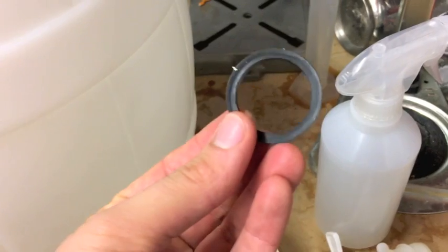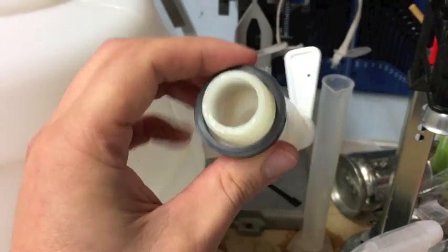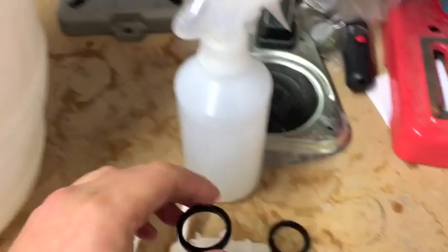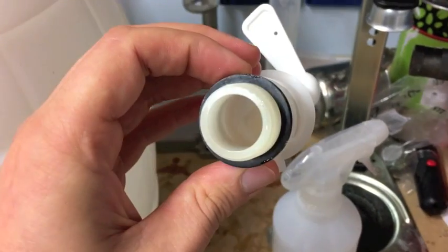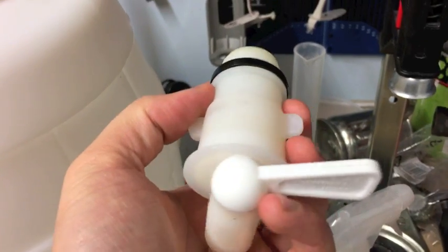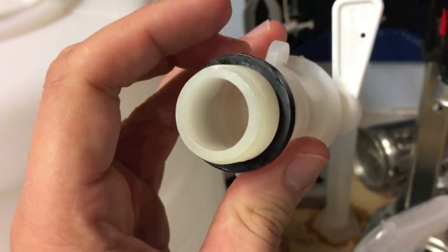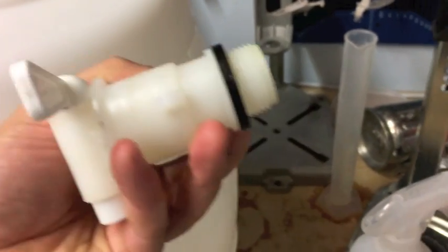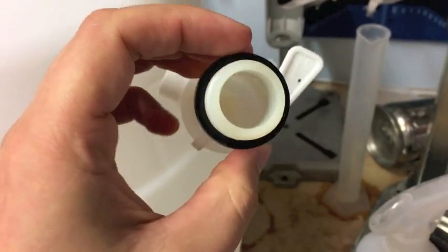The rubber washer for the tap has actually deformed quite a lot and is not really usable anymore — you can see how loose a fit it is, so that's not going to give a good seal, and I've got a replacement for that. The tap tends to be the place where I've had problems with leaks, so I would generally replace the washer if there are any issues. You can see the new one is a much more snug fit. The lip on these taps is not very wide, so you have to be very careful with how much pressure you apply to the washer, otherwise it gets squeezed out of place and deforms off the little lip that's supposed to hold it. I'm not sure why they don't just make that plastic lip a little bit wider, because it would help a lot with preventing the seal from being rendered useless by over-tightening the tap.